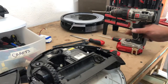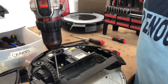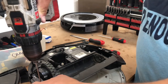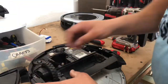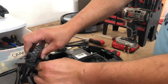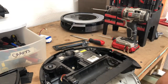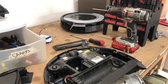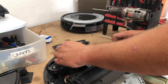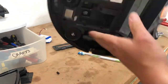Wheel number one is removed. Let's go to wheel number two — one, two, three, four, and five screws. Same thing: a little clip. Pull the wheel away from you as you hold the clip down, set the wheel to the side, clean it up, blow it out with the air compressor. Now you're probably wondering: do I need to take the wheel out? You don't have to, but we're doing a complete teardown. We'll set it aside and check for dirt, trash, and grime — as you can see there's some goodies hanging out in there.